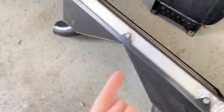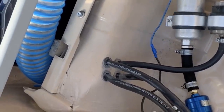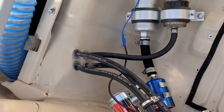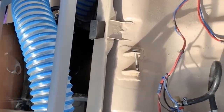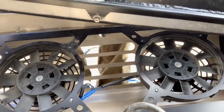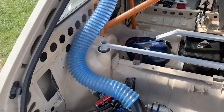I've bolted the cover cowling on properly for the last time. I just need to tidy up the fuel pump wires, and I've run a bit of neoprene around where the cowling is going to sit on the bottom of the car. Once that's all in, I can mount the pump, wire that up, and run another wire from the relay up the front to the fans that are underneath the radiator.